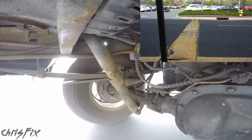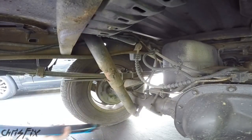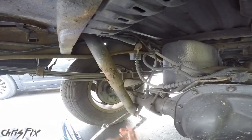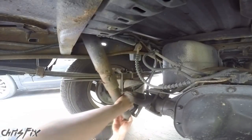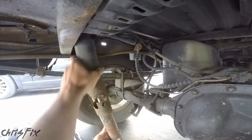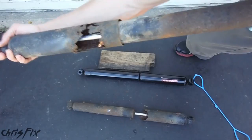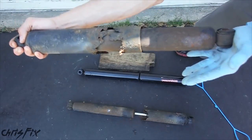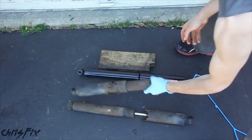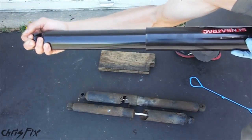Now let's change these shocks over to the new shocks and compare the difference in ride quality. Most shocks are really easy to replace — it's just two bolts, one at the bottom and one at the top. I have videos on replacing the front and rear shocks, so check the links in the description. With the shocks out, you can really see the difference in the old shock versus the new shock. The old shocks I could compress really easily with my hands and they don't feel smooth. These new shocks take a lot more force to compress.